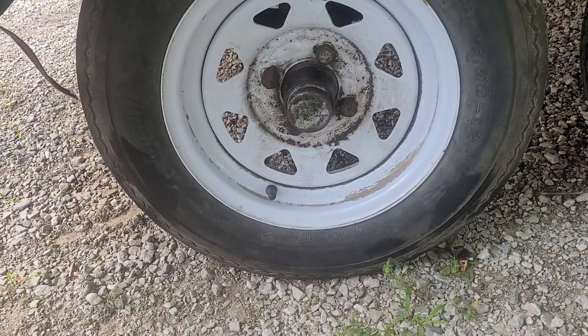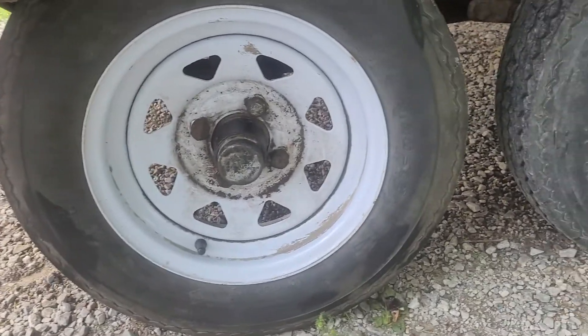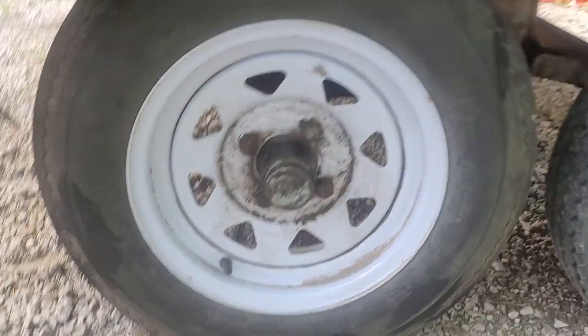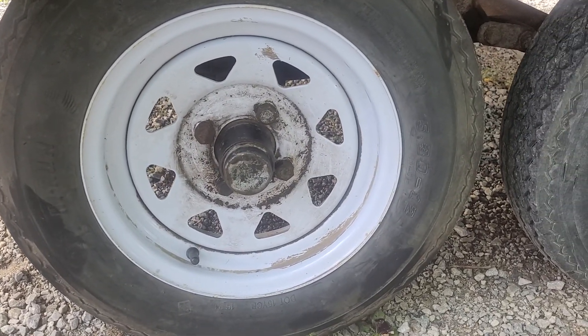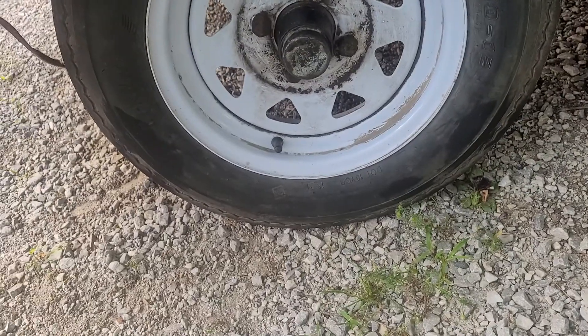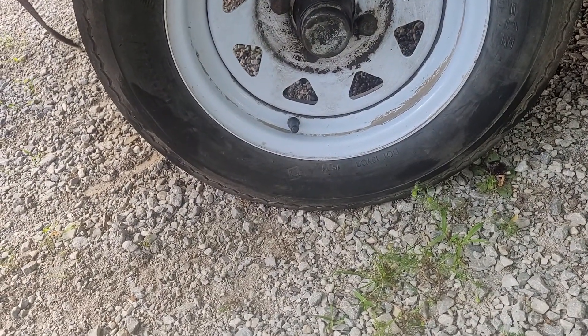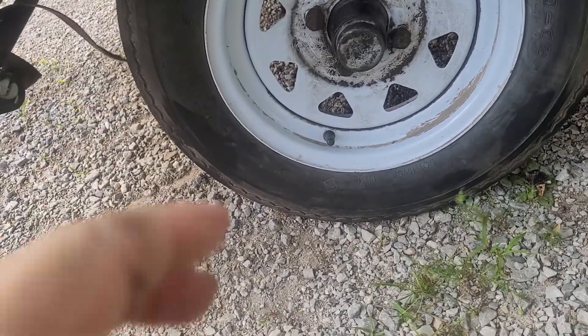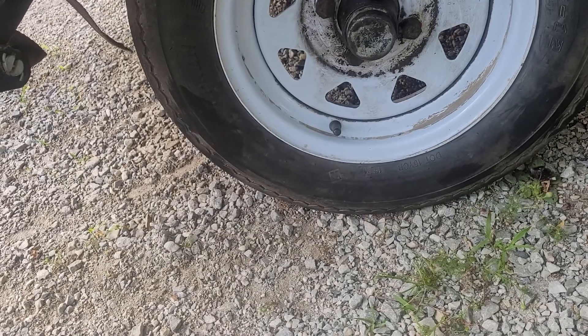This time I put even more heat to really melt the metals together. By doing that all the grease in the bearing melted and dripped down all black and crappy. So I waited till it got cold, pulled out my bearing grease, repacked the bearings front and back, and put it all back together.